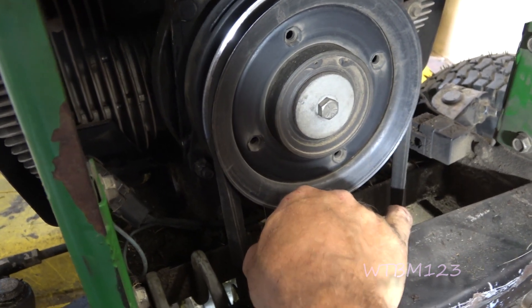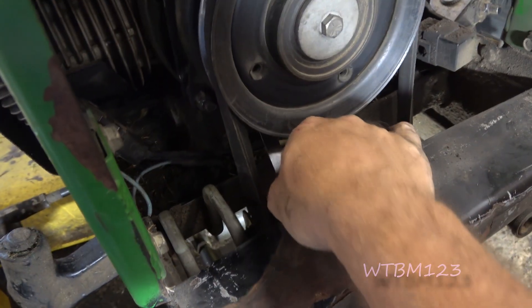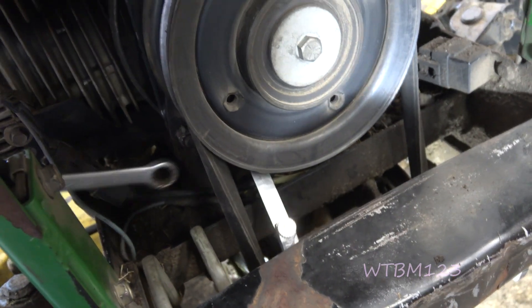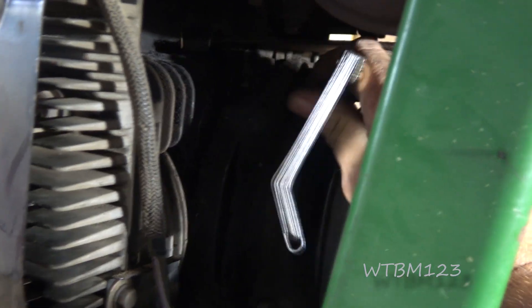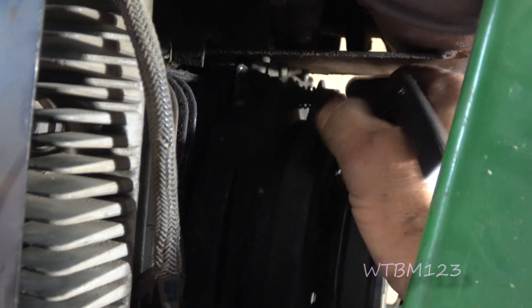Okay, that's pretty good — maybe just a wee little bit snug, but let's check the other ones first. I went around these several times. You don't want much drag on it; you want to be able to feel the drag but you don't want to have to force it. If the feeler gauge is too tight it won't move and your gap is too small. It feels pretty good there. And then the third one over here — they all just have the slightest little bit of drag on it.